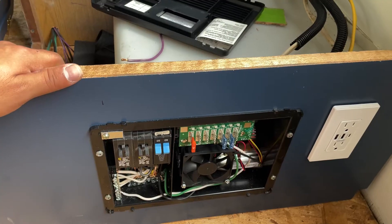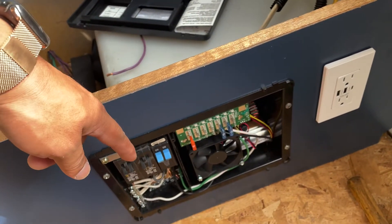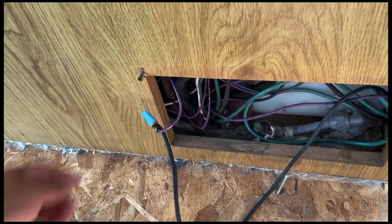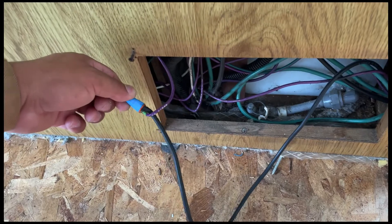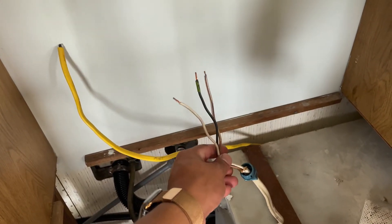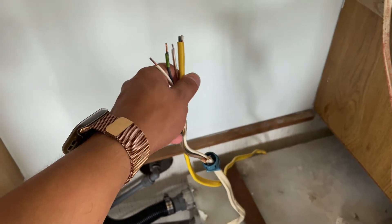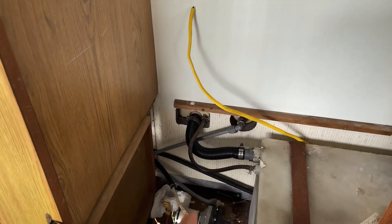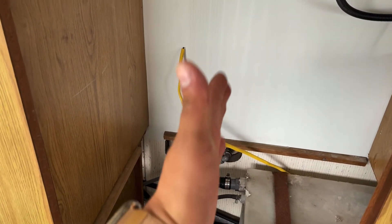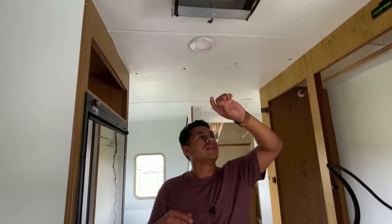The DC connections are wired in order — two lights, then the furnace, then the sensors. There were a few bumps during installation. First, one of the wires didn't reach the power center, so I added an electrical box to extend it — and since it was there anyway I added the outlet. Second, a 12-volt line also didn't reach, so I extended it with a waterproof wire nut next to the tank. The last wire also needed extending. My next move is to break this down, move it further back, and connect it properly. All right — we are done!